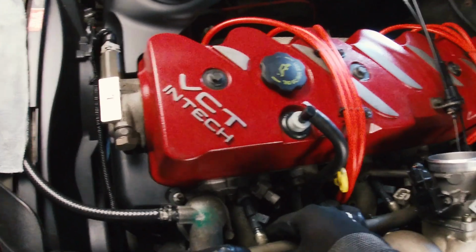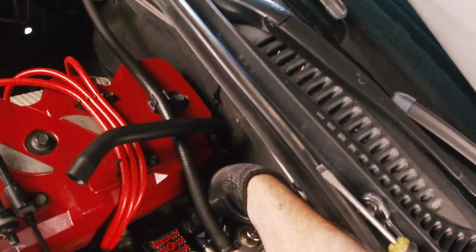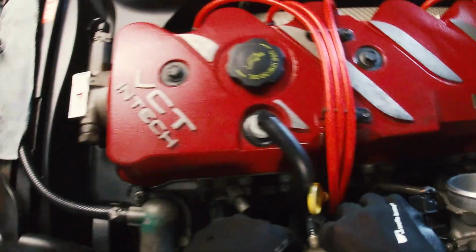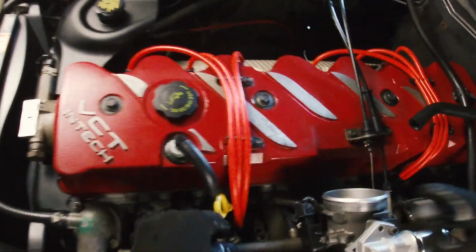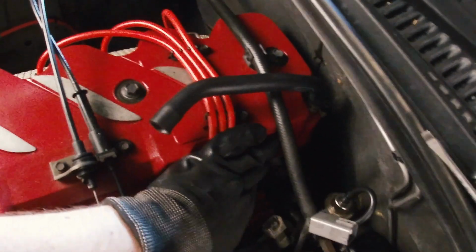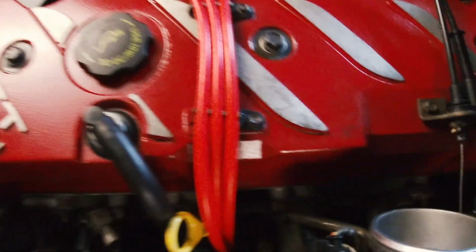And then you should just be able to make sure all of the injectors are sitting in the fuel rail openings. I imagine it's going to take a bit of force to get all these seated. So let's start ramming them in there. First two are in. It's a bit hard to get leverage or pushing force on the remaining ones. But I imagine if you just start bolting this back down, it's probably going to do the job for you.